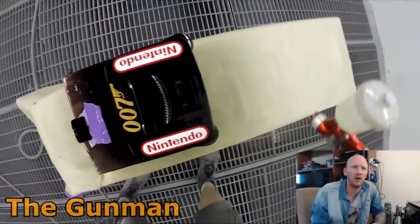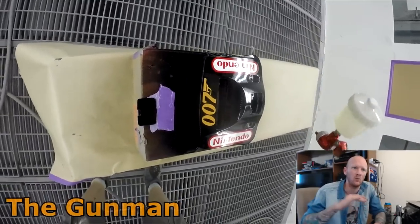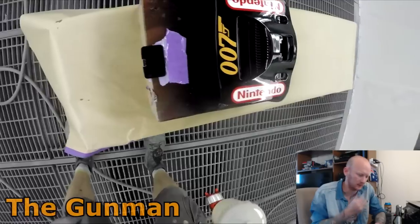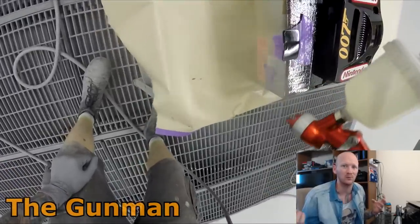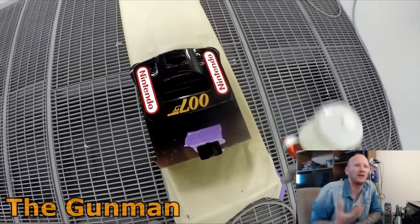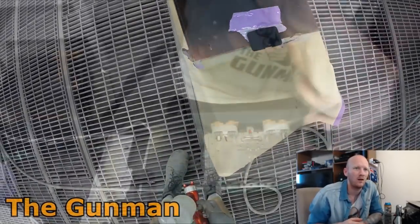And also a plastic part, you can end up getting a static charge to it. So if you go and wipe it down with the wax and grease remover, the rubbing over it can actually start staticking it up, and then all the dust in the spray booth or the workshop or wherever you're painting it will actually get attracted to it, and you'll have crap all through it. So yeah, I think not doing that stage in this instance was definitely a good thing.